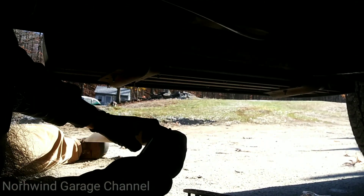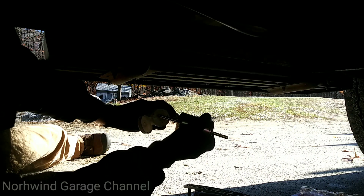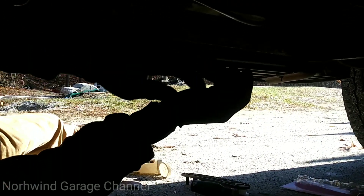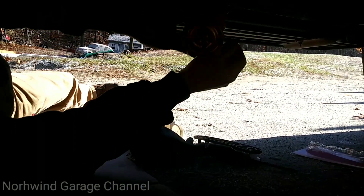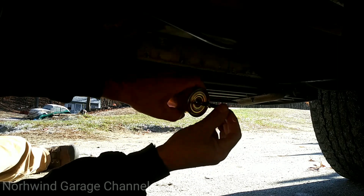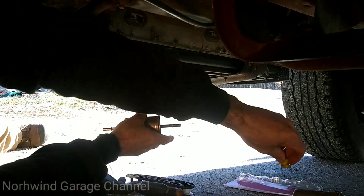On these I like to take a little silicone grease as a lubricant to lubricate the O-rings when you put this in. Just a little dab on there — nothing spectacular. Just to wet it so you're not pushing into a dry connection. It's not actually dry because it had fuel running all over it, but that's typically the way I put things together to help them go together a little better.